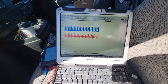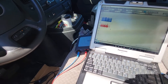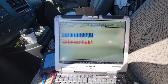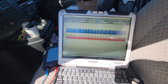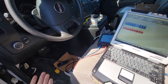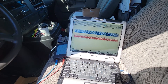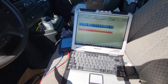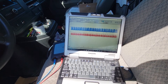You can see on the recording that the CAN bus looks like garbage — it's pretty much mirroring itself and the bias voltage is all wrong. So we need to look at the wiring diagram to see what the bus wiring looks like and isolate the problem. On these vehicles they're like a chain network, so if we unplug one module halfway through and it fixes the signal, the problem is on one side of the network; if it continues looking bad, the problem is on the front side of that module. That's an easy way to split the vehicle in half rather than unplugging modules one by one.